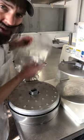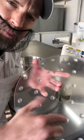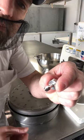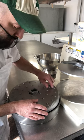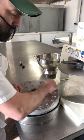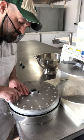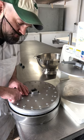Then you have the final disc. This one has these dots perfectly flat on this side, but on this side they're indented to accept the end of the plunger — we'll call it a plunger. That sits on top. Now you have these little screws, and you're screwing into plastic so you have to make sure you're perfectly lined up or you'll strip things. There are two of these and these keep the plates in the proper spot. They can be a real pain sometimes because they want to cross-thread, and you don't want them to cross-thread. Sometimes just wiggle it around a tiny bit until it's on the right track.